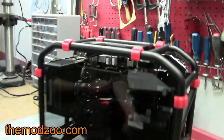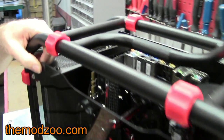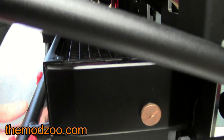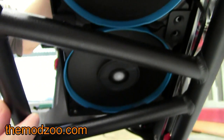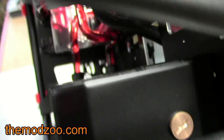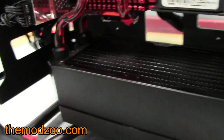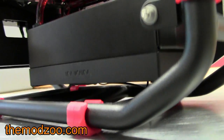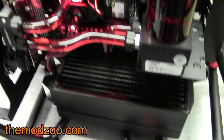Take off the side panel for a better look. As part of the water loop we have the Alphacool UT60 240 radiator, and I installed Corsair SP120 fans — they're a bit noisier but with this thicker radiator it gives good airflow through the radiator and helps cool the rest of the system. Those are the only two fans in the system since there are no other fan mounting locations, so I went with those fans to keep enough air moving, powered off a molex connector at full speed.